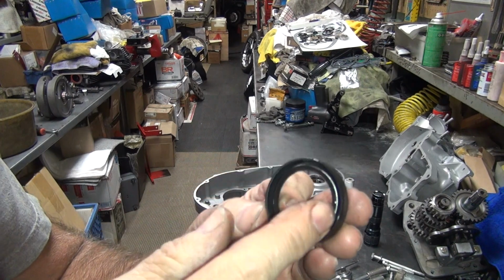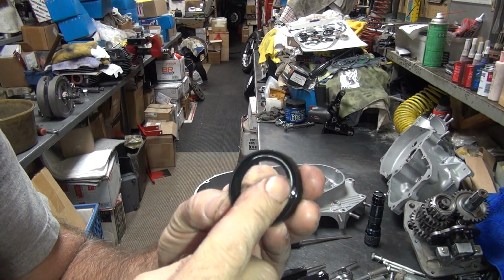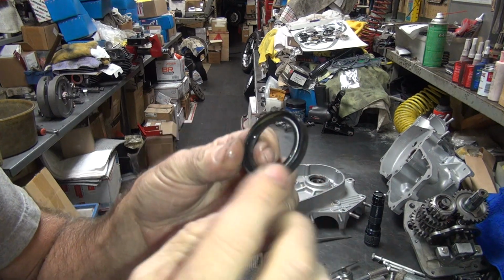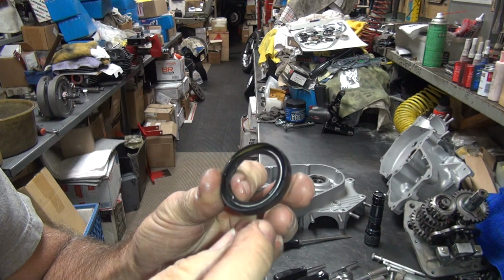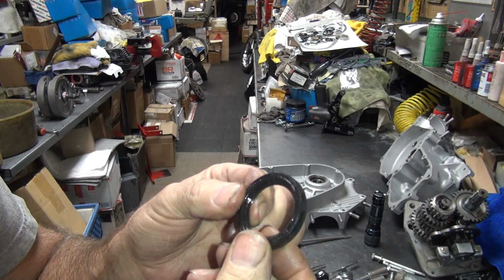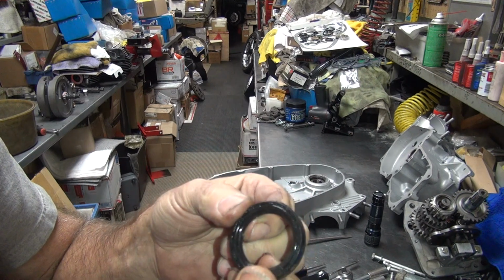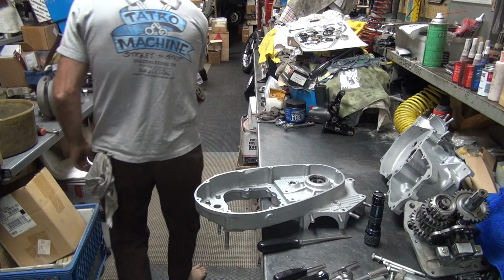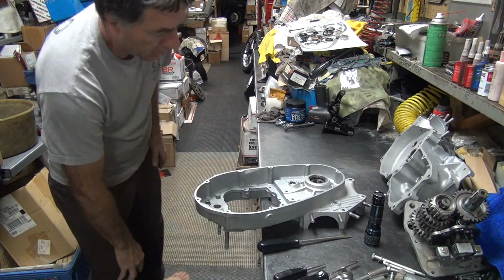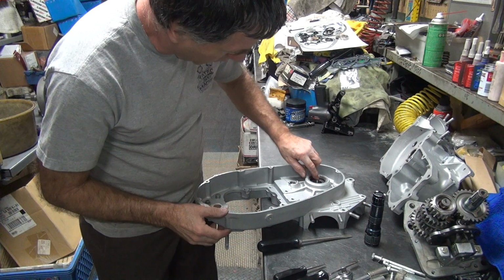Alright, let's see if I did any damage to it before. Looks like it was undamaged until I yanked it. Yeah, the spring was still good. So I didn't hurt it until I pulled it out, but it was in too deep, so it was going to rub on the bearing and chew itself up anyway. Wouldn't have worked very well. It would probably have leaked oil. Okay, so